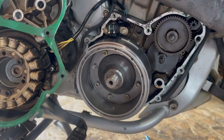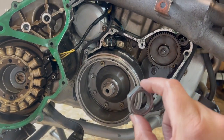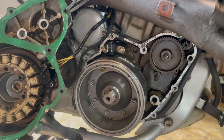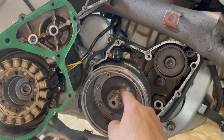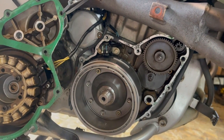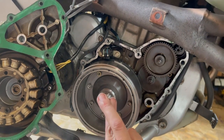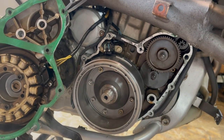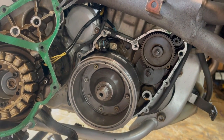It is critical that this goes to the correct torque and you don't over torque it or anything, because what happens is these wallow out if they're too tight, too loose, etc, etc, and that's what breaks the woodruff key. Fingers crossed. I'm hoping it's the solution, because I could do with this being reliable.